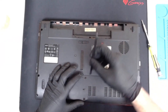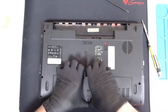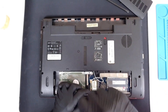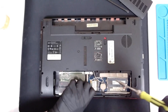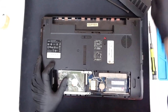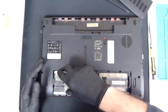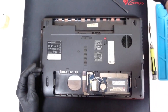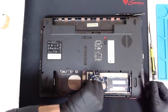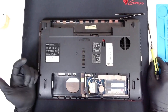I don't know what we're gonna find out inside. First thing of course we have to flip the battery. We have a screw in the wrong place — this shouldn't be here. So we can expect anything. Now we have to take out the hard drive. Now we're gonna remove all the screws on the back — they're the same size except the ones which are under the battery.